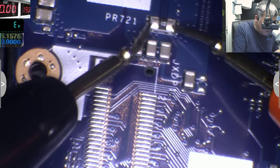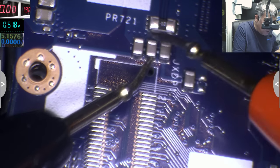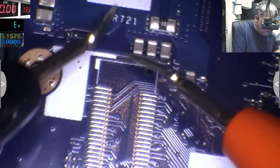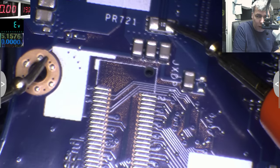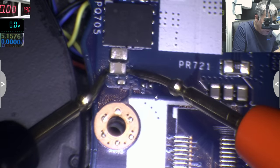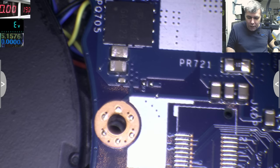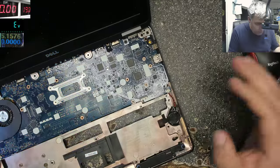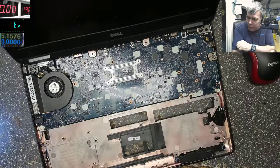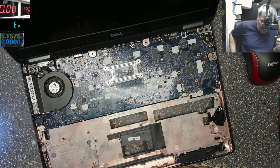Oh, possible. I don't know. This is a current sensor. These are a current sensor. These caps are not shorted to ground. What about this current sensor? Is it shorted to ground? It's not. So why are those caps shorted? Okay, you know what? Let's do what we learned, yeah? You can't really do too much with a multimeter when you have a short. What you do is start removing the old capacitors and cutting the power rail into pieces to find exactly what the short is.